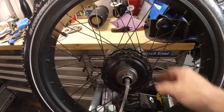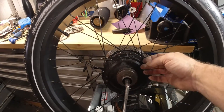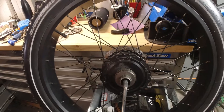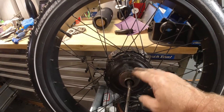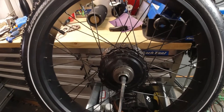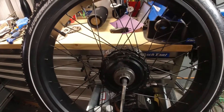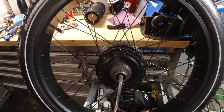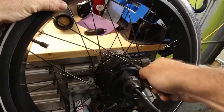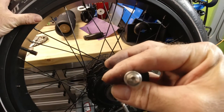I theorize that tool would likely collapse during the job because of the amount of force it takes to get one of these off when they're threaded on tightly. So I'm going to take this motor cover off and see if I can separate it from the electric motor inside, then move the whole assembly to my bench, get the freewheel tool inside, and somehow adapt something to try and apply that force. It's gonna get complicated but we'll see how it goes. You'll need a security bit — the bit with a little tiny hole in it — because they put security screws on this.